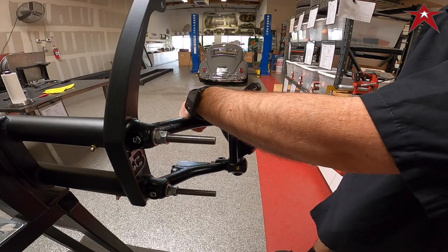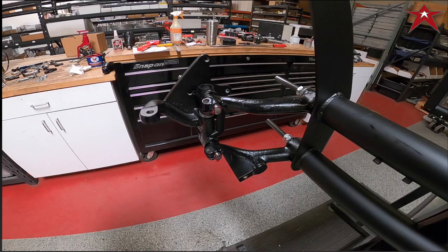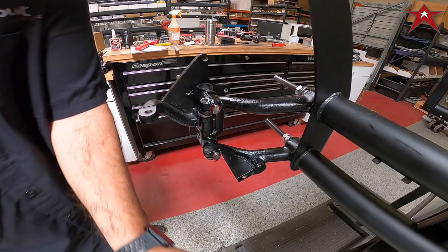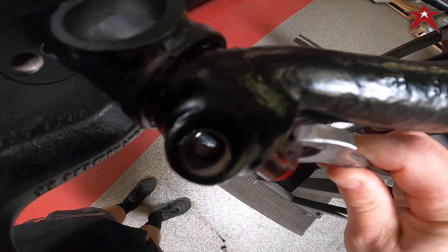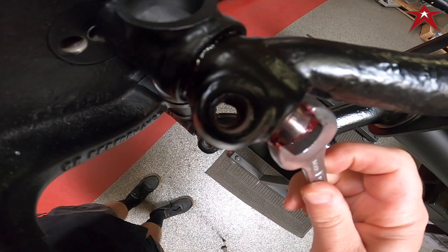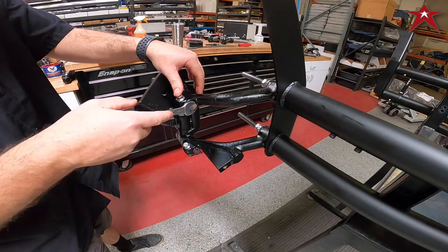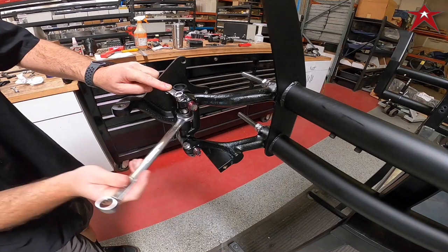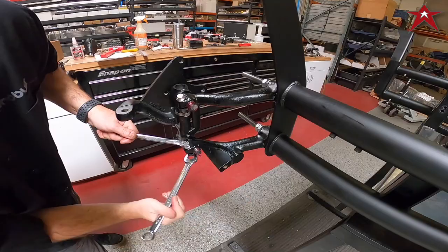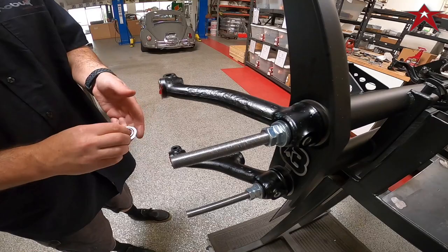A nice soft rubber mallet is ideal — don't pick up a hammer and destroy the finish. When adjusting link pins, use a 9/16" wrench; you can use a 14mm but it's a little tight — the 9/16" has a little wobble to it. Inside the hole in the upper and lower control arms where the bolts go, you can slide a bolt through once the notch is aligned, and that allows you to pull the link pin tighter or looser to shore up the connection. We're using the stainless hardware kit — link below — and we use anti-seize on that hardware so you don't seize them together.